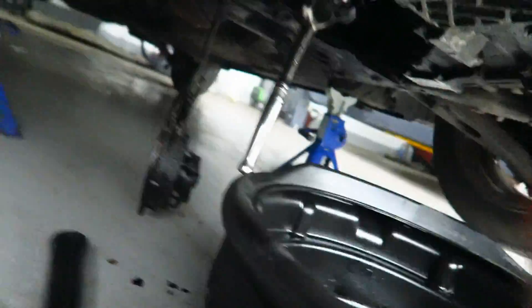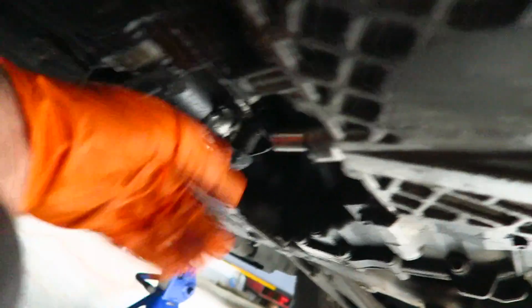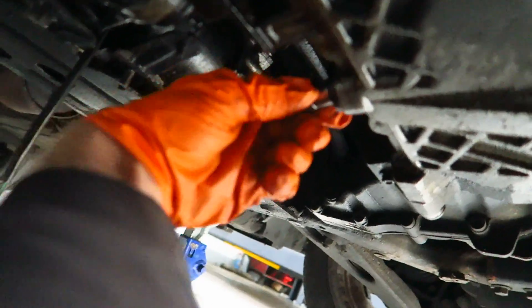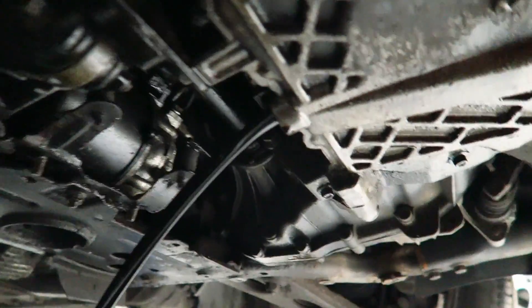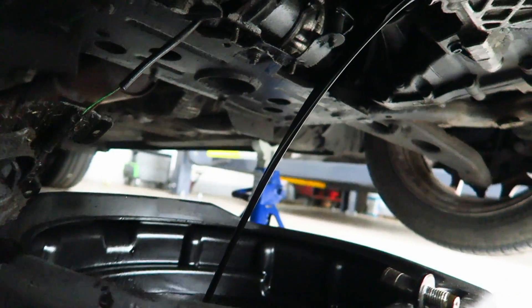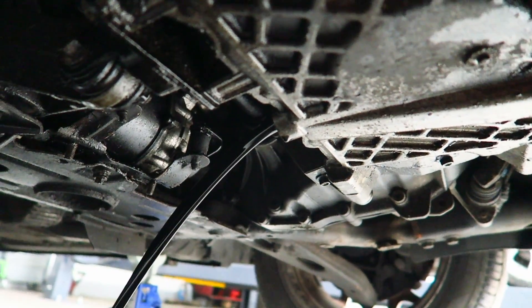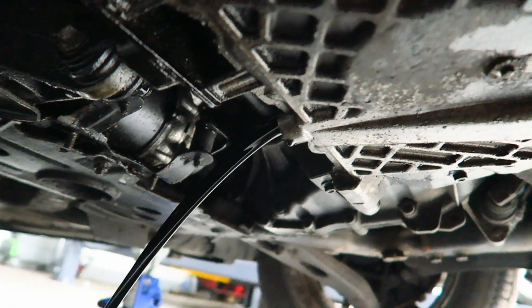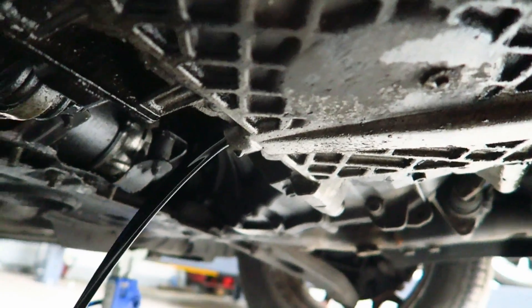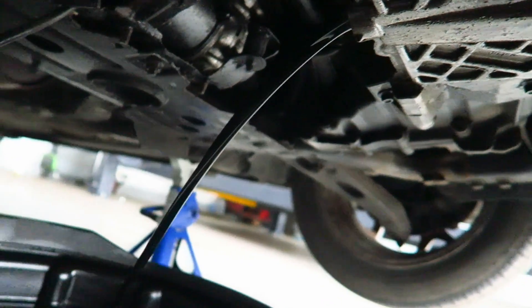I've got it loose — had to whack on a 12mm, really tight, and that's coming now. Strangely enough, the oil hasn't got any cream in it whatsoever, it's actually quite oily. I expected it to be a little bit creamy, but this just shows it was only on its way out — because it actually wasn't that bad. I drove it all the way home from London with it being fine, but I did expect a little bit of cream, not going to lie.